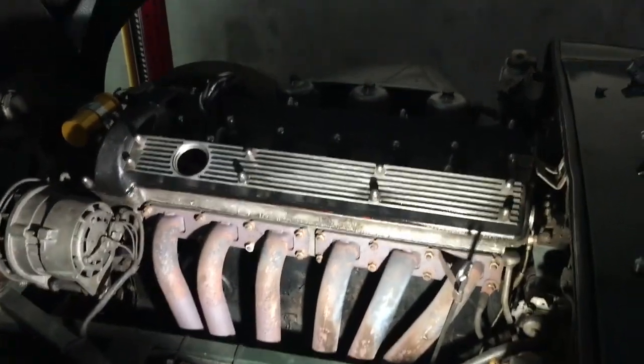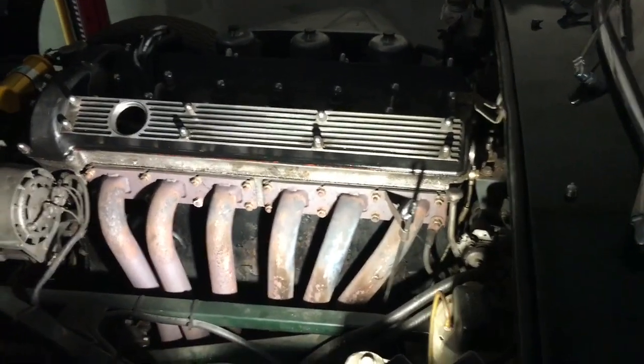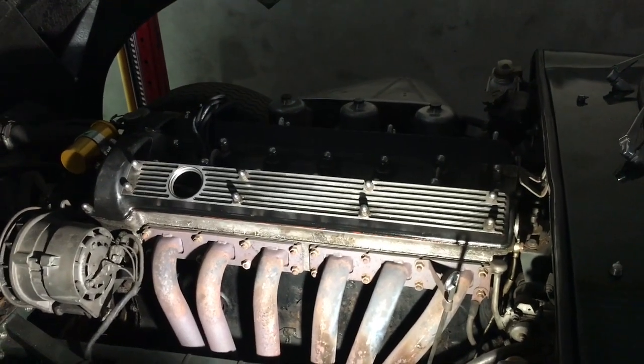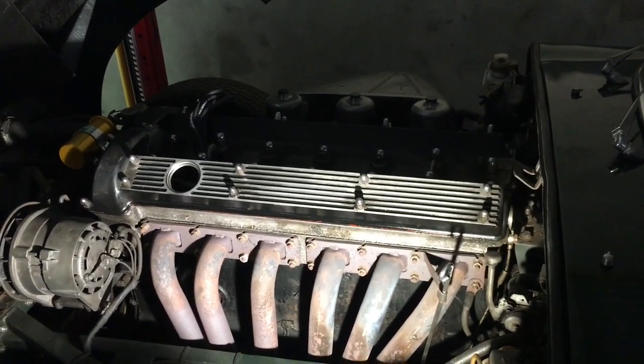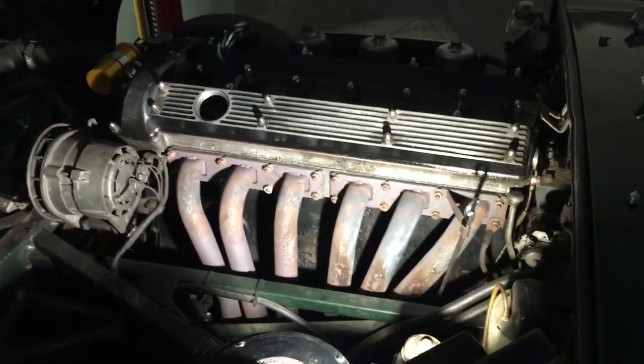So what you should do is put in 14.5 pints after you've done an oil change, and then check it. Run the car to temperature first, then leave it for about an hour, and then check it on the dipstick to make sure it's full, and mark that as your full mark.